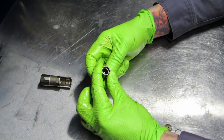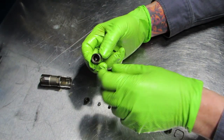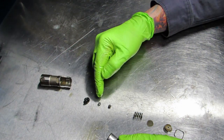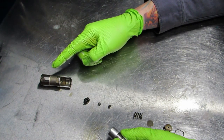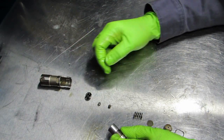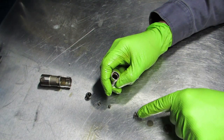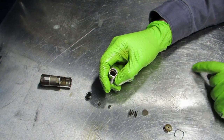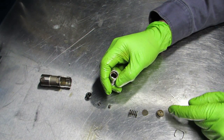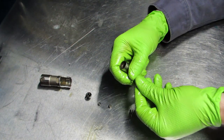The inside of the body has many tight clearances, just like the outside. It has a check ball on the bottom that's going to feed your roller. It has a spring that holds the check ball in, and there's a retainer to hold that. On the top side, going towards your rocker arms, you have a spring with its retainer and the top that feeds oil through your push rods to your rocker arms. And then again, you have the circlip.